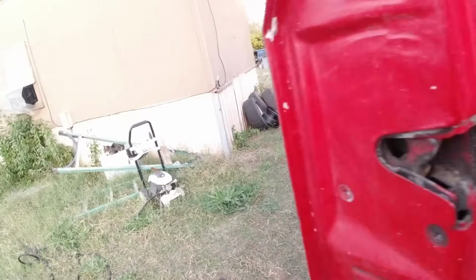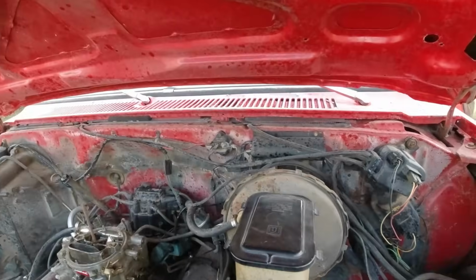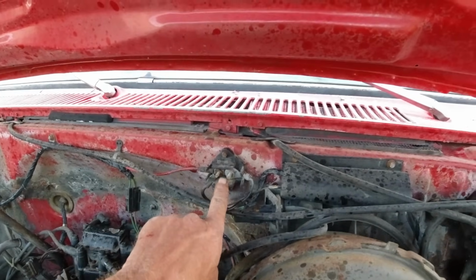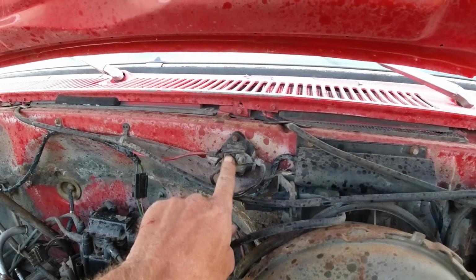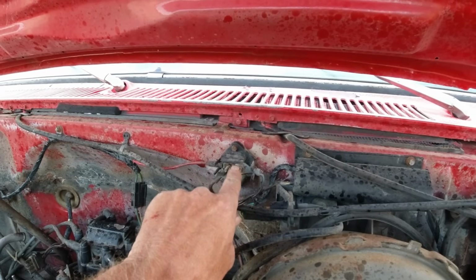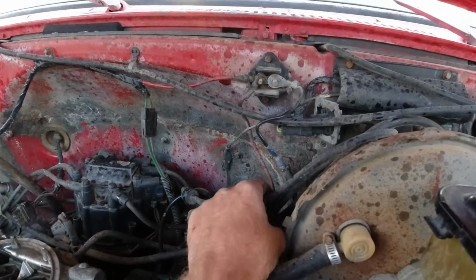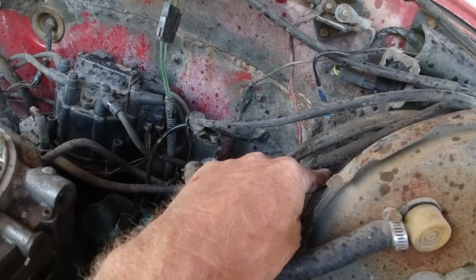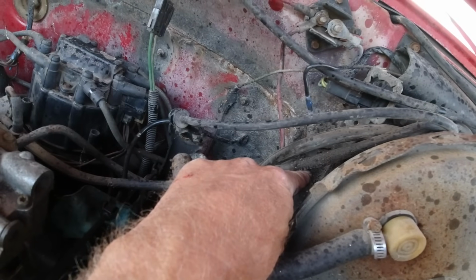So then I go back up here and it's getting power to here and here. There's a connector behind here that connects these two, so it's actually part of this deal here. So it was getting power. And then I went down here. Here's a fusible link, and it goes down here. And I scraped a little right here and checked it. No power past the fusible link.